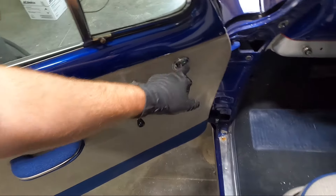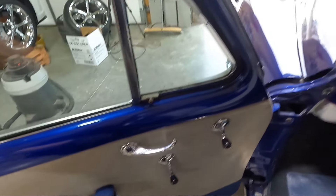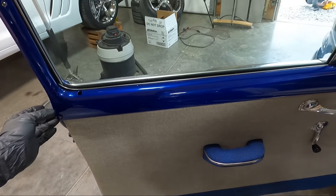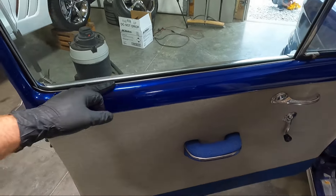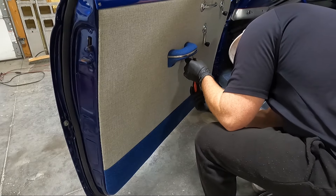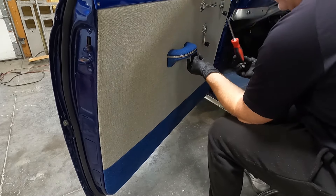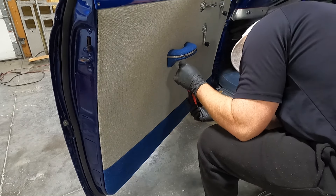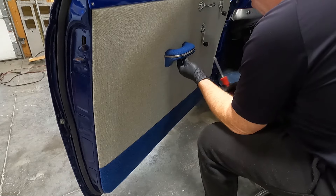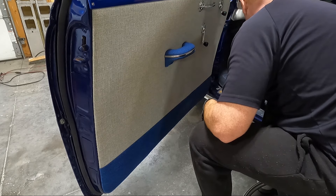So I'm going to start by getting those three clips out. I just use a pick to push those out — generally I don't lose them if you're careful. We also have to unclip the door panel or the door card; it's clipped in. When we go back together however we are going to have to remove this piece — this painted piece — it just makes it easier to get it back in. So I'm going to go get my chair and we're going to take some of this stuff apart. These things have a little closeout on them that take little Phillips screws, and my kit that I bought actually comes with that also. I love this tweed guys. But like I said this door handle actually goes down now — I fixed it by backing it out with washers but that's not technically the way it's supposed to be done.